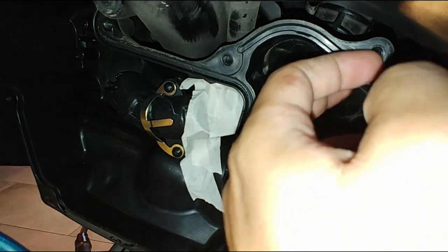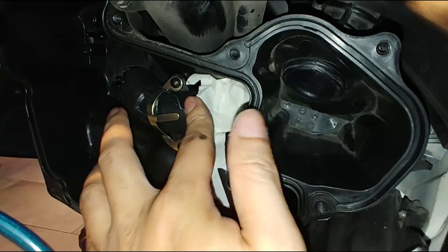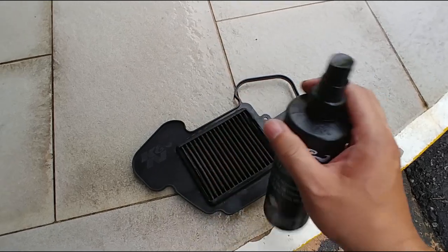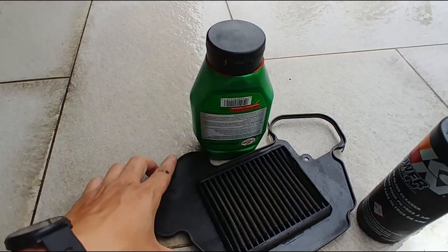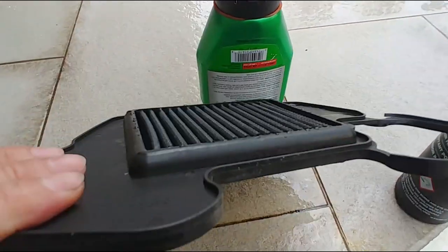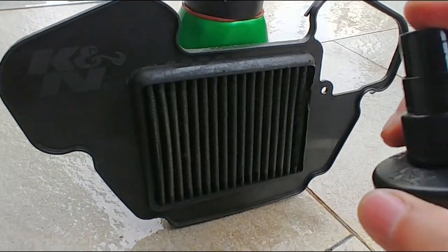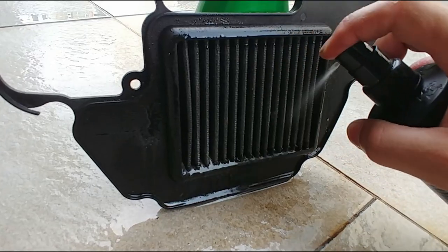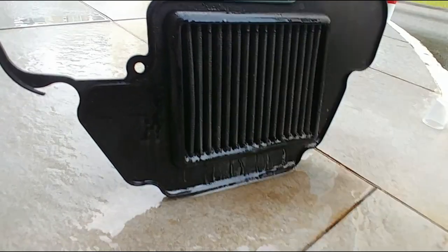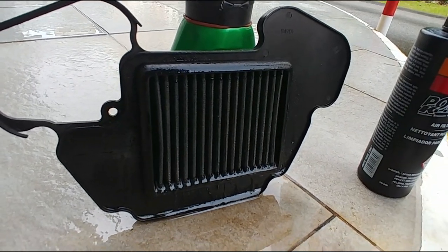This part is fine because this is the air intake — before air goes through the filter and enters the engine. Then we bring these two items to wash. We have the cleaning solution. Use something as a support and keep it upright, because we want the dirty water to flow down but not flow back through. Spray the solution from top down, and you'll see it becomes a light grey. Then let it soak for about 10 minutes.